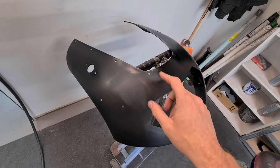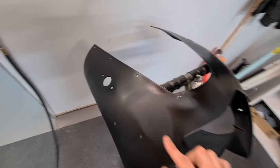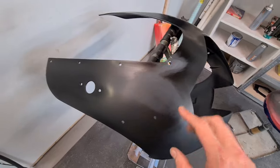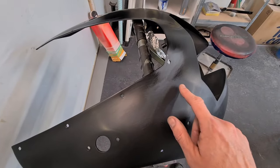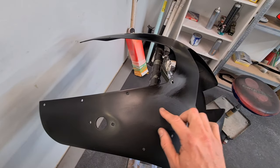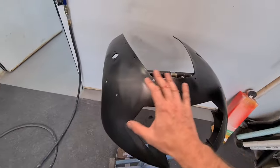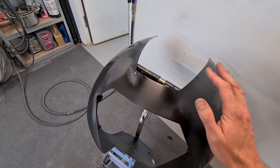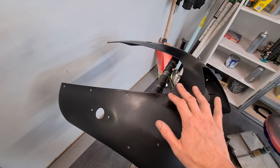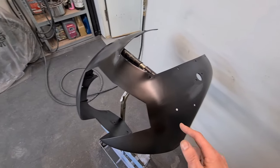This nose cone — what I'm doing is sanding out these cracks, dimples, and bumps. We've had a crack there which I've filled in with some clear coat. There's one there, one here, one here, and one little one there — it's very hard to get these covered up. This is in clear coat at the moment and I'm sanding the clear coat down. If I were to apply the vinyl stickers on there when I squeeze them out, you would see bubbles and air pockets where these dents and defects are. So this nose cone needs to be as perfect as possible — it's been painted so many times, green paint, white paint, red. I'm going to dust over some base coat to get rid of these areas and then may have to re-clear the whole thing.